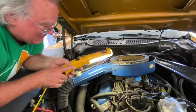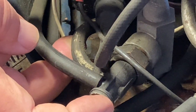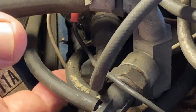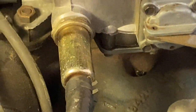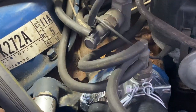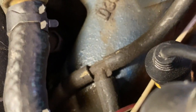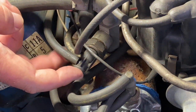This is something new. This is the hose for a thermal switch for the EGR valve that only allows it to work when the engine is warmed up. The hose goes back to the EGR valve behind the carburetor. This hose normally goes to a special port on the carburetor for ported vacuum. But when I started to play with this and push on it, it was making the same hose move up here as for the vacuum advance diaphragm. If the camera can get above there just right, you'll see there is a little plastic T, and that ported vacuum off the carburetor is being shared between both the three-port thermal vacuum switch and the source for the EGR vacuum switch.